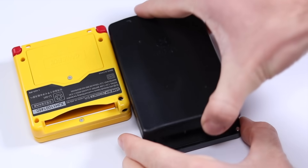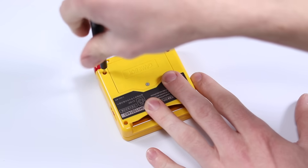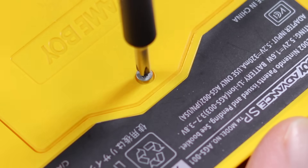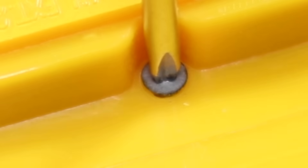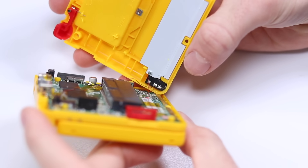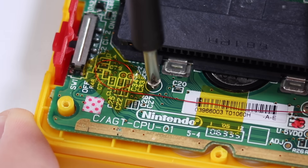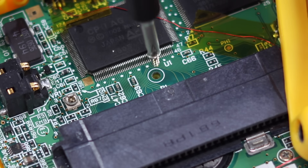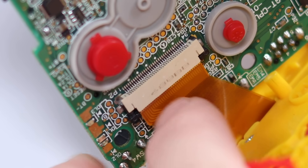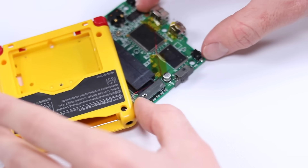Right, let's get on with taking this Game Boy apart. I'm actually quite excited to see the inside since it's been a good few years. Okay, let's have a look. Oh boy, there's a bit of a nest of wires. I've got to be really careful not to snap these wires, but there's the original volume slider and it just makes my blood boil. Let's remove this motherboard further — there are three Phillips screws that we need to undo. Now that we can lift out the motherboard, I'll be able to carefully detach the ribbon cable and take it out entirely.